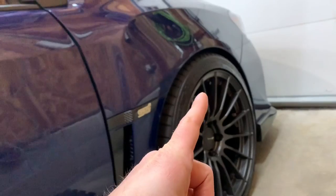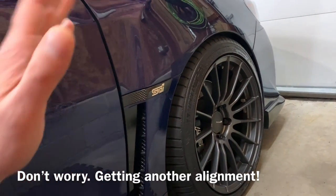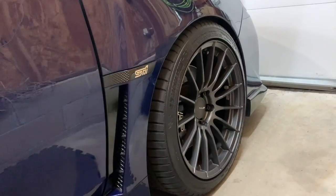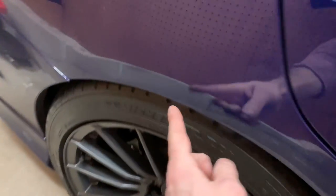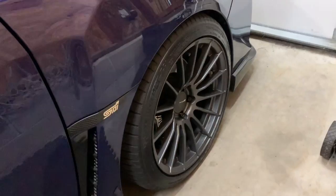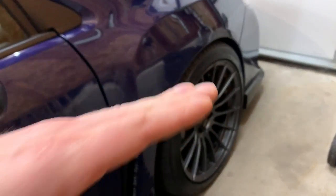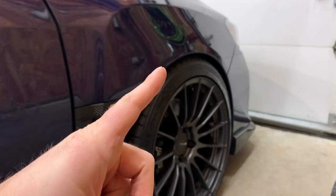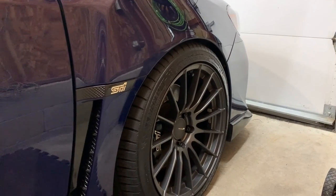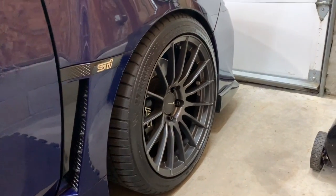I'm also going to lower the front a tad. I did work on the camber a little bit after the alignment and everything is good with the camber, but I kind of want to lower it just a little bit more. The rear is low — I measured, and I'm 25 inches exactly on both rears from the ground to the fender. At the front I'm 25 and a quarter on the driver side and 25 and an eighth on the passenger side, so I'm going to lower it to 25 even. It's only a small difference but that's just me being OCD and making sure it's exactly how I want it.